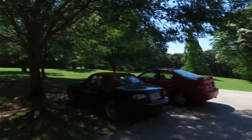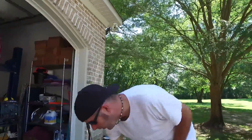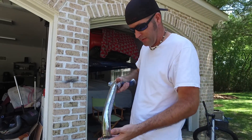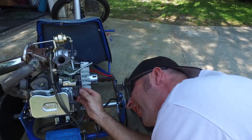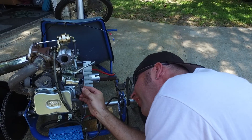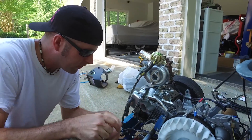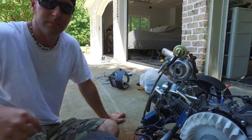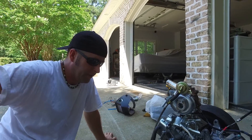We made a flange, got a hose, and got some Harley exhaust pipe. We're going to have to dimple the pipe a little bit. The lineup looks perfect — I can't believe it. The threads look terrible but the fit is good. I'm thinking shorter is better for the intake pipe — that way it's a straight-in shot.